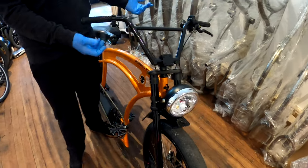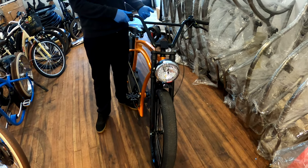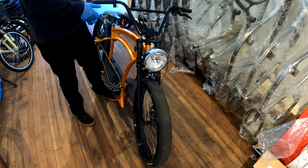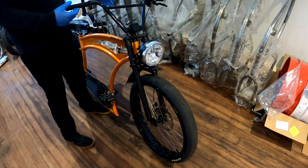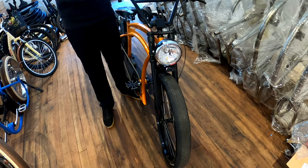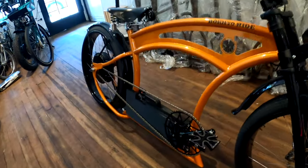So now when you're riding, you can actually activate the rear regen only. By doing that, you're gaining a lot of regen power back to the battery charging because you're only using the regen to slow you down. When you need to come to a complete stop or have a stronger stop, you can add a little bit of the front brake and that will stop you on the dime, no problem. And even going down steep hills, it's no problem at all.